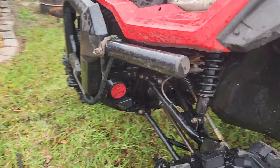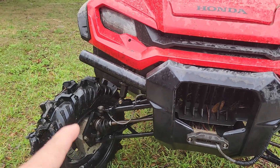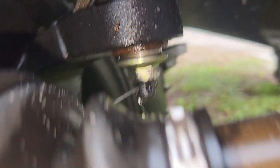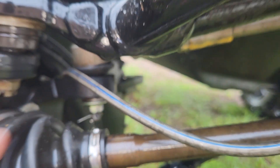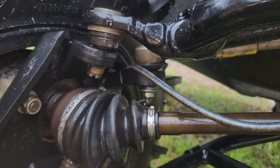So if you're going to put portals on your 2022, you really want to make sure you put some spacers — you can see it on this side too. Put some spacers on top of that nut, otherwise you could have a dangerous steering situation on your hands. It'll also destroy this part of your portal backplate and get wallered out.